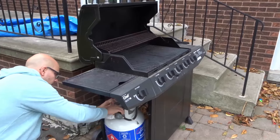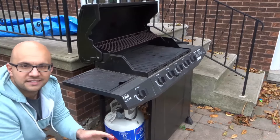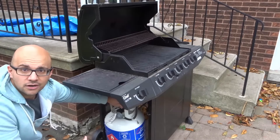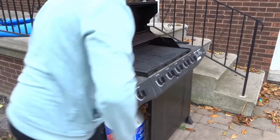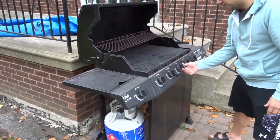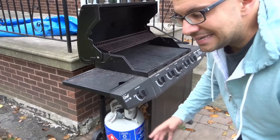After you've waited about 30 seconds, put the propane line back on and make sure it's twisted on nice and tightly. Make sure your knobs on the grill are still off. Now, to prevent it from being activated again, turn on your propane tank slowly — nice and slowly — so the regulator doesn't think there's any sort of leak. Then go to your grill, turn on your igniter grill knob — in this case it's the center one — and ignite your grill just like that. You should have a nice full flame because you've reset that regulator.